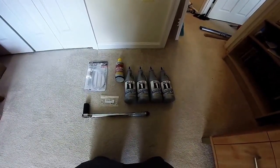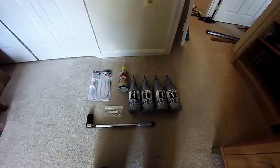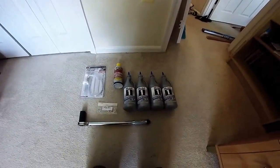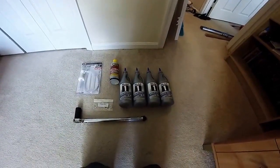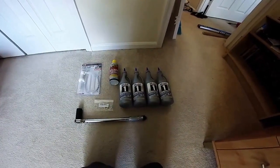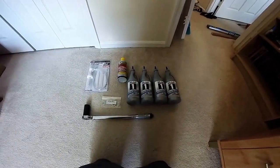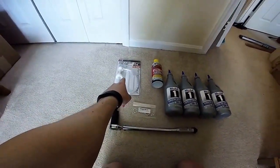The oil you need for the differential is 75W90. I know they recommend a different weight if you have regears or do any kind of towing or hauling, but I don't, so I'm going with 75W90 as the Toyota manual specifies. I'm going with Mobil 1 — these are about $12.99 each. I got four of them because you need just over three quarts, about 3.15. So just for the oil you're looking at around $46, which is already saving me about $50.